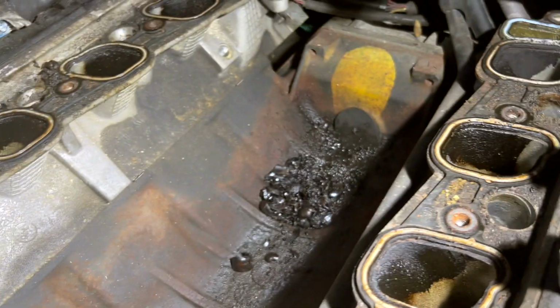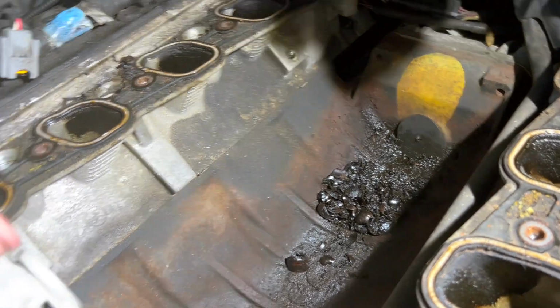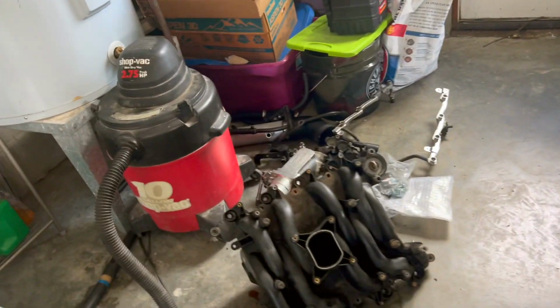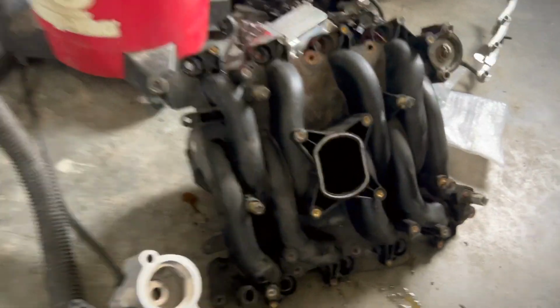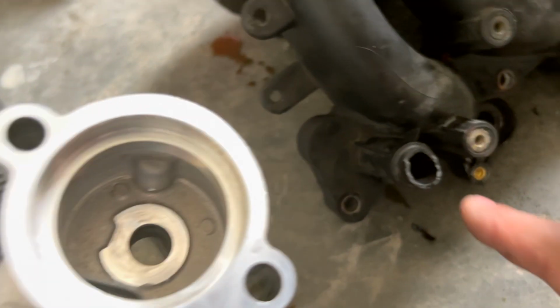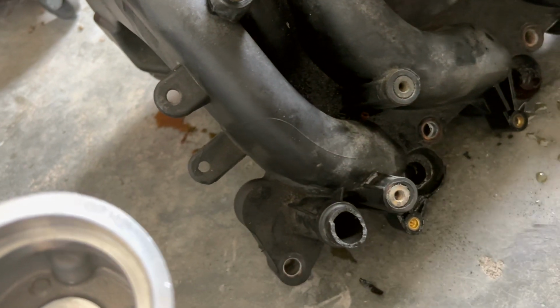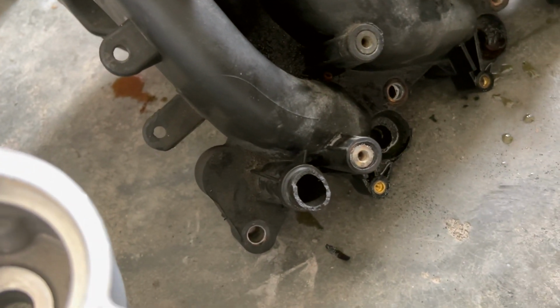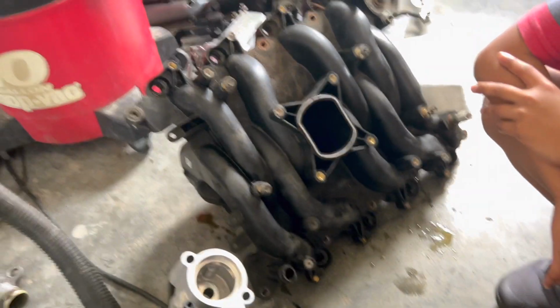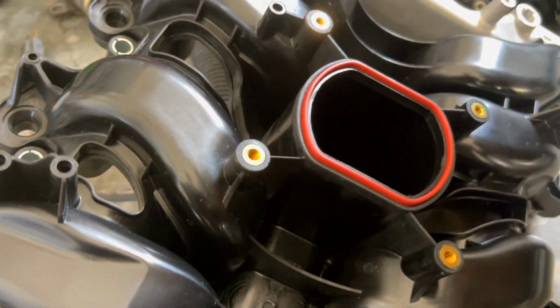And that's the coolant, oh, my bad, that spilled over from the thing cracking. Also, I need to show them that. Why are we changing that? This is the reason for changing out the intake. Where this is right here, I'm going to have to take that off with some pliers. It busted on the old one, as y'all can see. That thing busted off, brittle plastic. And I lost coolant. Didn't overheat the car. Saved the car, didn't overheat it because the coolant was spraying all over the windshield anyway. And that's the whole reasoning for changing this out, right?